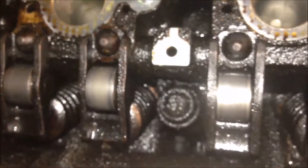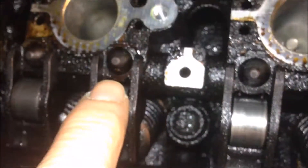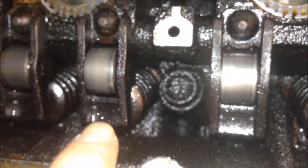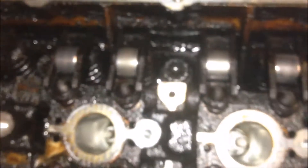For the rocker, you can see there's a hole here for splashing oil. I've already cleaned that as well. This is the roller, and this side is the well, so you can see the well over there. And over this cylinder head, you can see oil everywhere here, but there's no draining hole. But there are going to be three draining holes — one is down there, down there, down there. So all the oil will flow to these three drain holes.